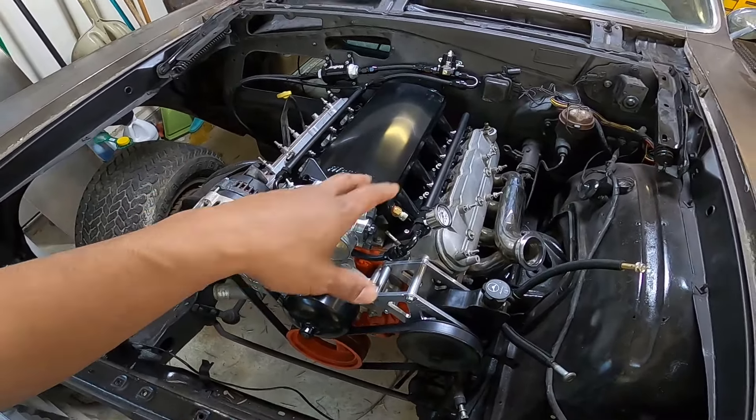The Skylark is the one I initially wanted to take but there's just too much to do — the drum brakes need to be upgraded to disc and I'll need to sort out room for the brake booster and dual master cylinder. So I don't want to pressure myself to get it done by August. We're not taking the Skylark to Hot August Nights this year. It's really going to come down to the Camaro or the '33.